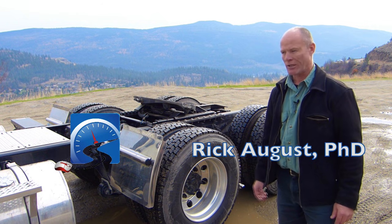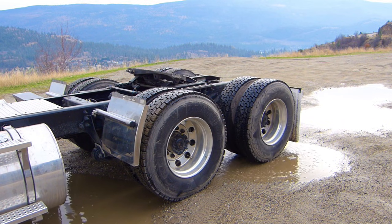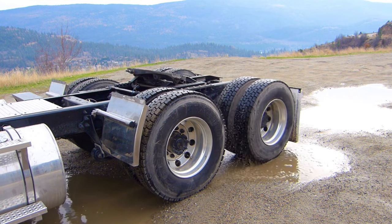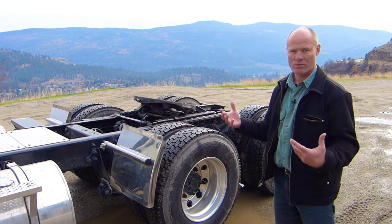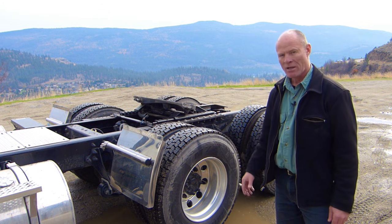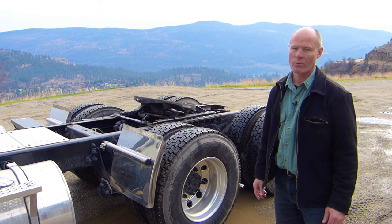The differential lock on your truck — as you see here in the image, you can see that the back tire is spinning and the truck is not going anywhere. The reason for that is the differential, which allows one wheel to spin faster than the other. If one of the axles is elevated — in puddles or on gravel surfaces — the wheel will spin and the truck won't go anywhere.